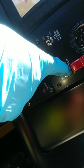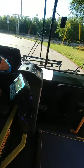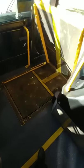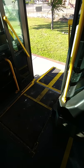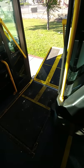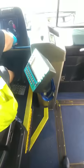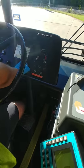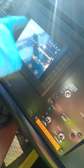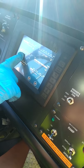Here is where I would check my ADA — kneeling my bus, opening the door, deploying my ramp, pulling it down, then bringing it back in. Then turning the power off, un-kneeling my bus, and closing my door. Switching the screen, you can check your fluid levels — oil should be at least 30 PSI or more, my transmission, my water, and my cooling levels.